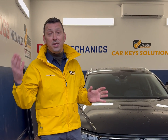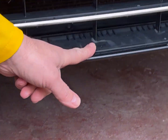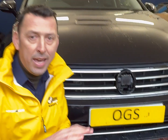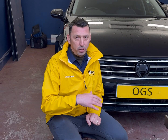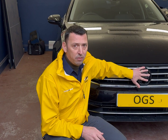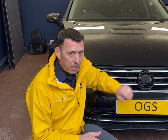Whenever it gets replaced or even if it's been removed from the car — on some vehicles we found this system located on the lower side of the bumper, and we had a situation where the bumper was clipped ever so slightly on the curb. It bent the bracket of the sensor and put it out of settings. So even when the new bracket was replaced, the calibration had to be performed. It's very sensitive — if it gets moved out of place, it needs to be calibrated.